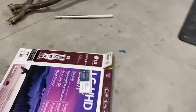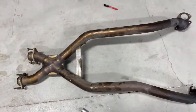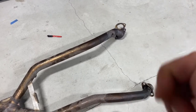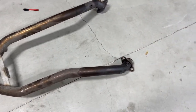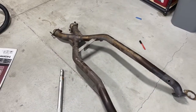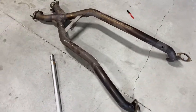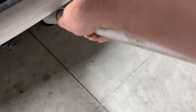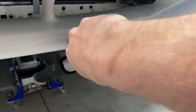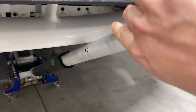Where's my jack handle, aka the breaker bar? Here's another tip guys: when you are installing O2 sensors, you don't need to install them to 8,000 foot-pounds. I literally had to use maximum gas to undo this one because some knucklehead decided he wanted to hang on the wrench. There we go. Let's get this jack out from under here, because who needs an extra layer of safety.